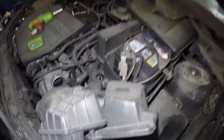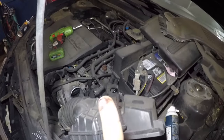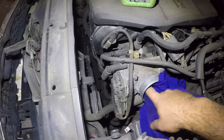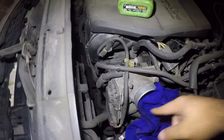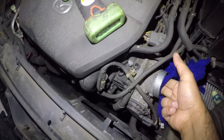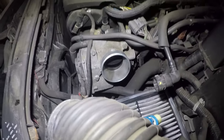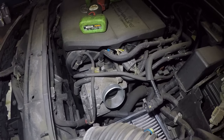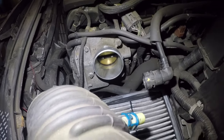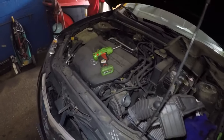It's not going to cut your finger, but you might mess up the calibration on the throttle body. And you see all this carbon coming on my finger? That's all the dirt that's in there. It's pretty much choking the engine — that's what it's doing. You probably have low RPMs. This job is very simple. I'm going to keep cleaning this, do the same thing, and then let go of the pedal — and the throttle body goes down. It's getting cleaner, but I'm going to clean this whole thing and put everything back together.